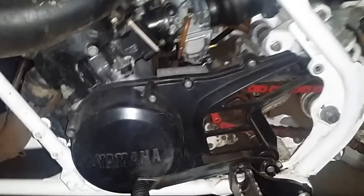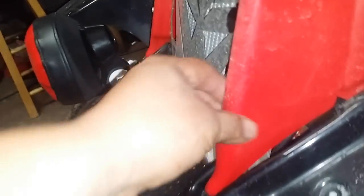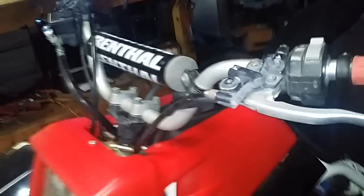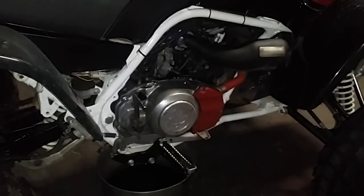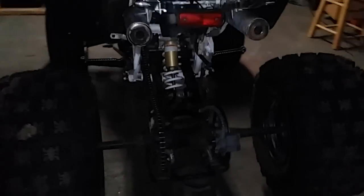Pretty sure I'm going to pull the engine and split the cases and find out what's going on. I tried cranking it on a jack stand and that didn't work. There are a few small things to repair — the plastics are kind of funky and don't line up, could be a bent radiator support, it's missing some bolts. I'll probably clean it up and put a good perch on it. The big job is going to be the transmission. Tomorrow I'm going to pull the countershaft sprocket off and try to get it fired up that way so I can verify if the engine is good or not, because the guy told him it did run fine.